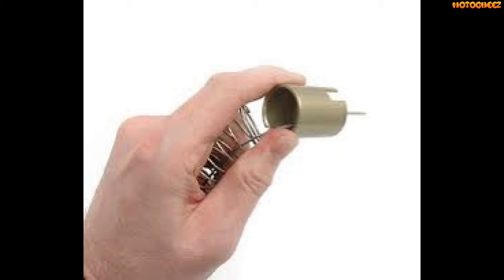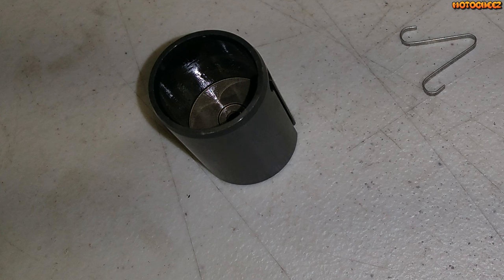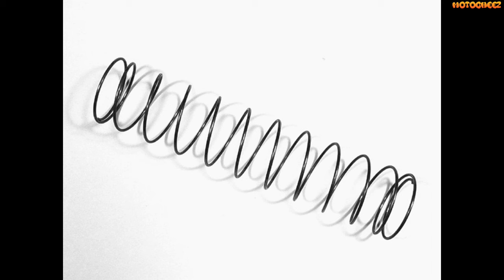I couldn't get a picture of me removing the spring to take the throttle cable off the plunger, but you can see where the little slot on the side is when you hold the spring back. You push the cable out through that slot on the side and then the cable will come off. Don't let the spring fly, and then you can take the plunger off.